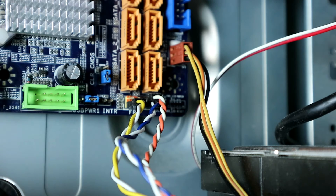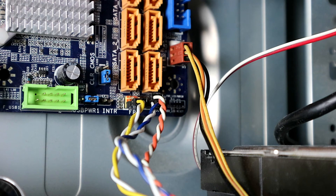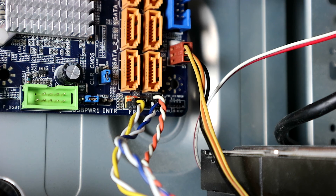So this is it — this is how you do it on different systems. It's pretty much the same procedure: find the minimap, find the pins, find your cables, plug them in. Don't break the cables, and make sure the LEDs are the right way. You can easily test it — if the lights don't blink, you'll have to flip them. I hope this helped. Make sure to subscribe to support this channel. Have fun assembling your computer, and see you next time.